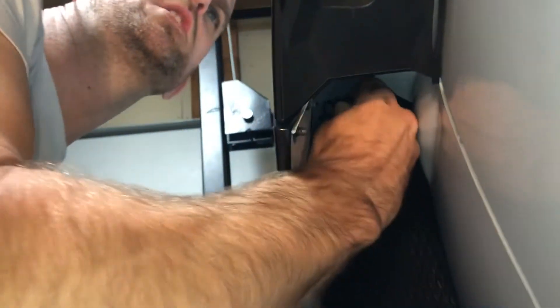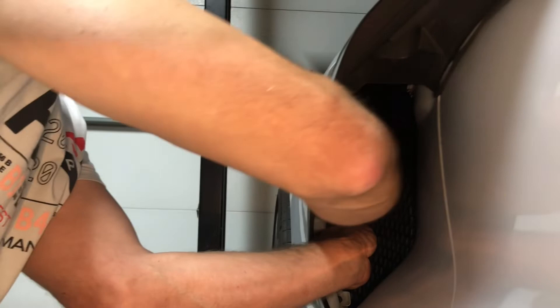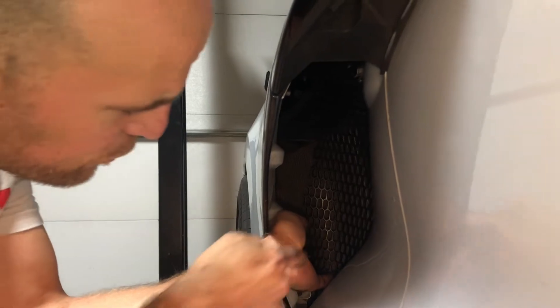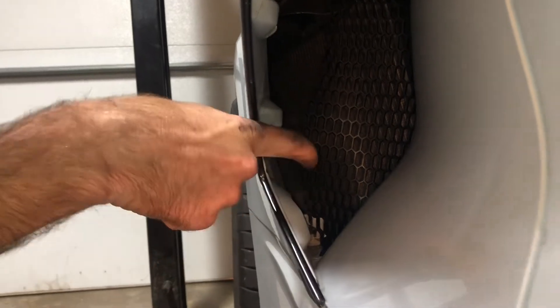Once there, you can pull up so that peak goes as high as it can go. Then reach in with both hands around the outer edge and pull the screen forward. With those hands wrapped around that outer edge, concave the grill screen in the middle and bring it forward to get in front of this body mount screw at the bottom.